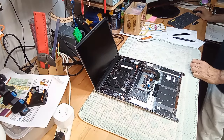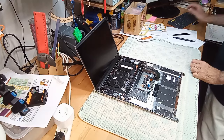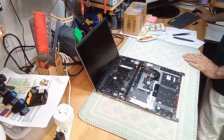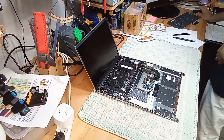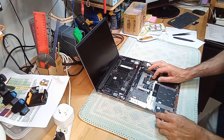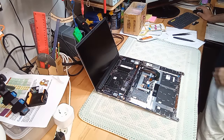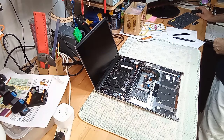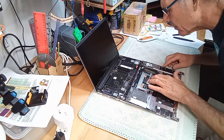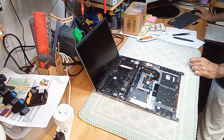Okay. Like so, yes. Once properly connected, let's verify. Okay, that's good. Make sure the touchpad side of the cable is fully inserted. The touchpad part of the cable, this is here, is fully inserted. Yes, it's fully inserted. Okay. The cable should be inserted far enough that the white line almost touches the receptacle. Yes, it does. Okay. If it is not inserted far enough, you'll need to push it in.